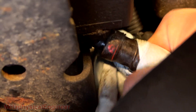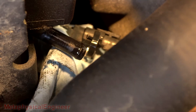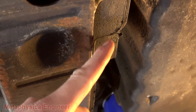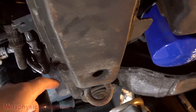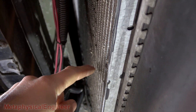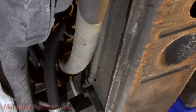Got rags underneath just so it doesn't drool all over the alternator, and should just be able to walk it off the barb. Since I've cut it beneath, it just wants to essentially fall out of the engine bay, which I can let it do. Going to use a short section of flex hose to connect the old return line to the new aluminum return line, following about the same path just behind the subframe. It's going to hop over the subframe, sneak around the radiator, and the cooler is going to mount down low somewhere up in here. Return line will exit the cooler, come back around, and then go up and join the reservoir.